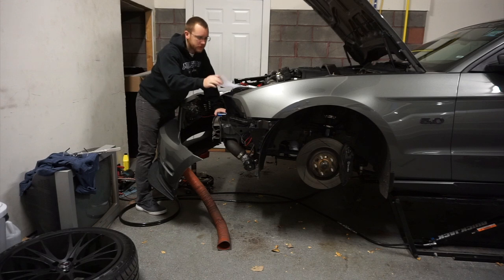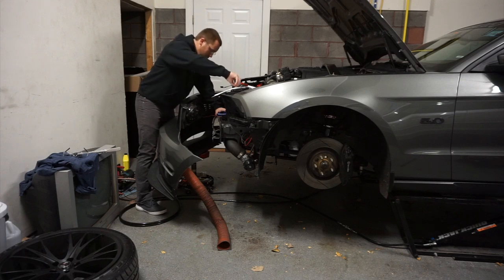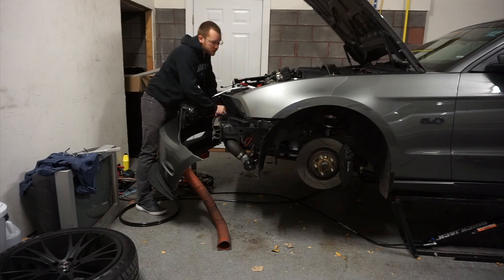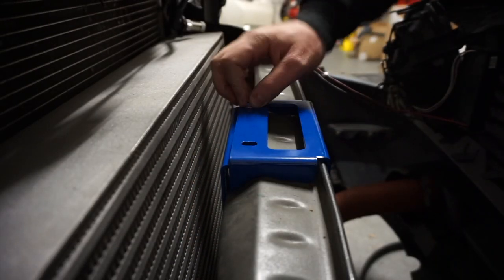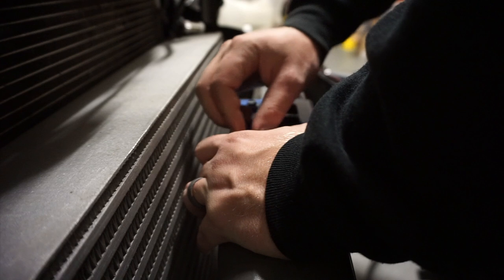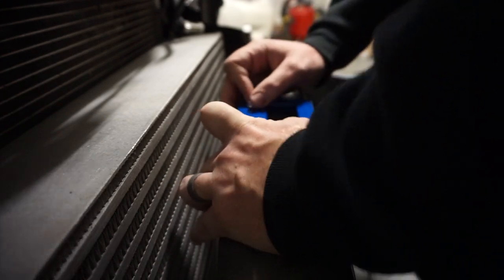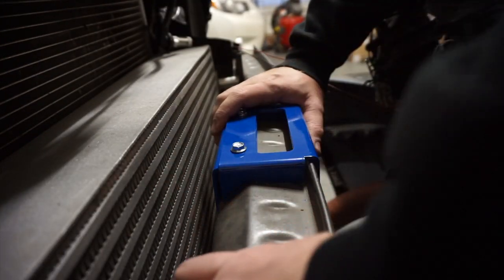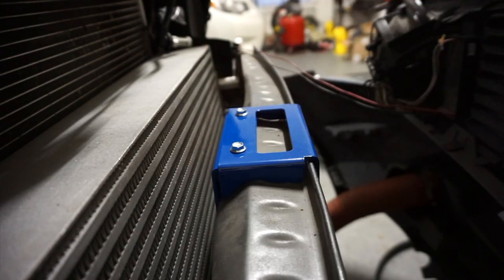There's two little metal clips that pop on to the unit so that the two bolts from the top have something to thread into. So that's the bracket started on the front bumper. Now we're just going to keep tightening down the two little bolts here — not all the way, just finger tight, because you probably still need some wiggle room. The next step would be to put the brackets for a front splitter on, but I don't have a front splitter, so basically skip that step.